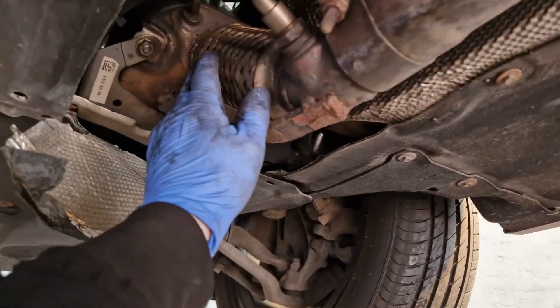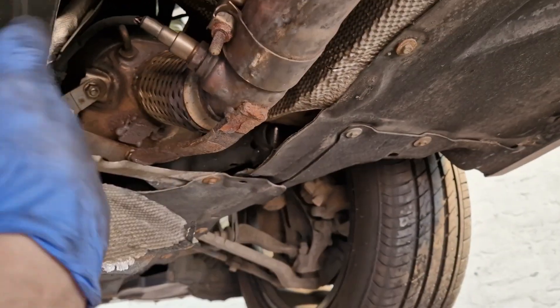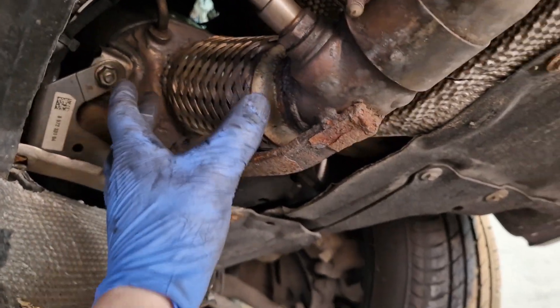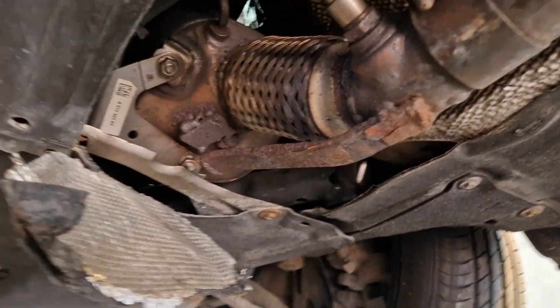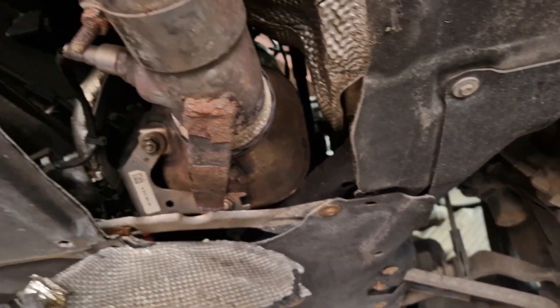This you could fix. And I'll put a little picture of how I do it - I'm not slating anybody but I'll show how I do it. You don't do that because then you're putting the flex in but doing all that is putting a straight pipe in there without any flexibility in it. It needs the flexibility to be able to move, otherwise things break. And clearly that's what's happened here.